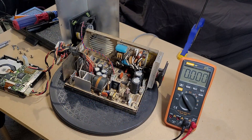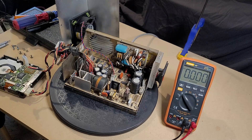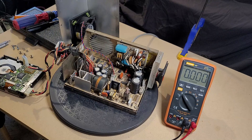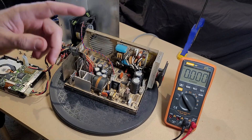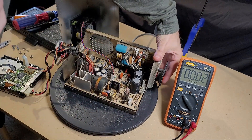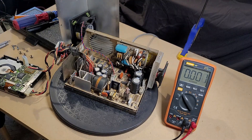Alright, I've got the power supply connected to mains in the back. I've got a non-functioning hard drive attached to the Molex just to give it some load — I think without load it might not fire up. I do have the fan attached just to see if anything's coming through, and then if it powers up we'll check it out on the multimeter. Okay, everything is spinning, hard drive is spinning — let's check the voltages at this Molex connector.